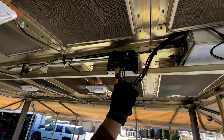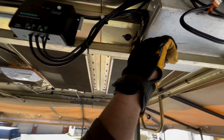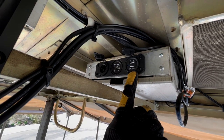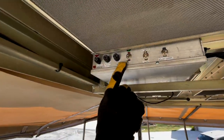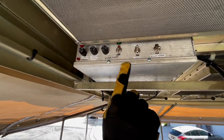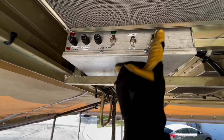There's a solar panel on top of the trailer and a solar panel controller. You can read the voltage of the battery there — the battery will charge great during the day, giving you enough power to run lights and the water pump. There are a couple of fuses and a switch for turning the water pump on and off. Make sure the water pump is turned off when you're not using water. There's also a switch for the exterior lights and a switch to turn off the charging of the battery from the solar panel.